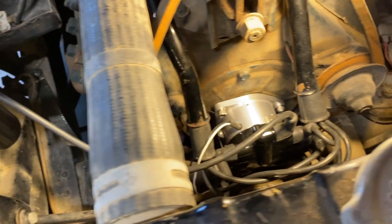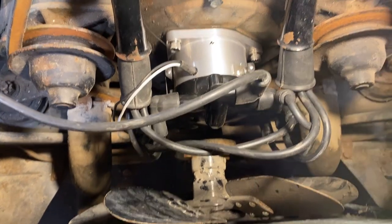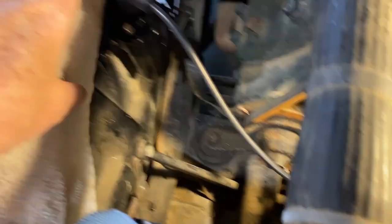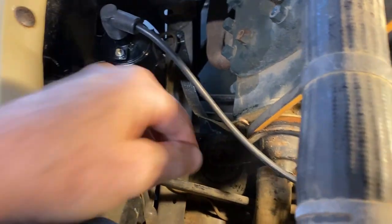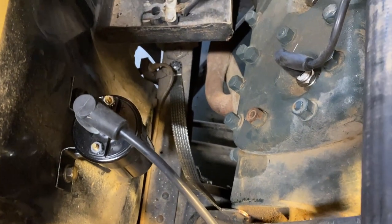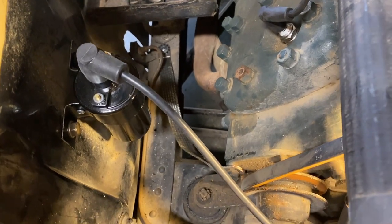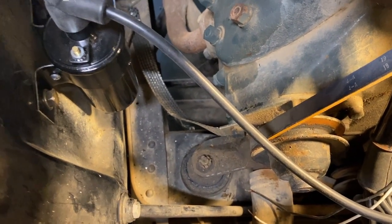I've got one I'm going to have to redo. Anyway, it's in place and fits very nicely. You're going to route your wires in such a way that they do not make contact with the fan, and you have plenty of clearance there. We've got the coil mounted on the fender well and the coil wire in place. Now we're going to take the two wires that come off the distributor and lengthen them so that they can reach the coil. I added an additional ground strap — when you're running this hotter spark ignition, it's recommended that you have an additional ground strap. While we've got one in the back, I added an additional one up here just to make sure that everything works properly.